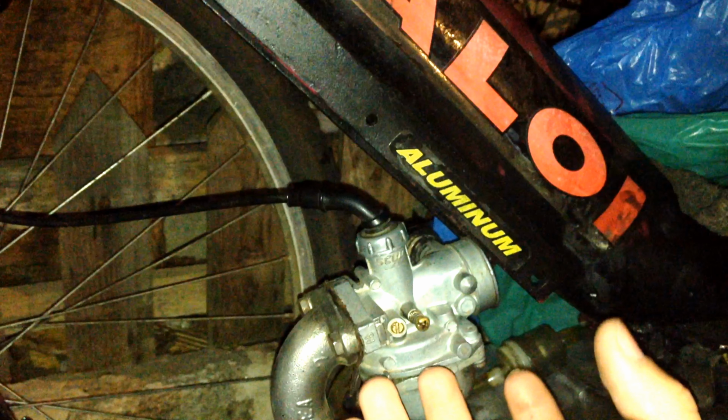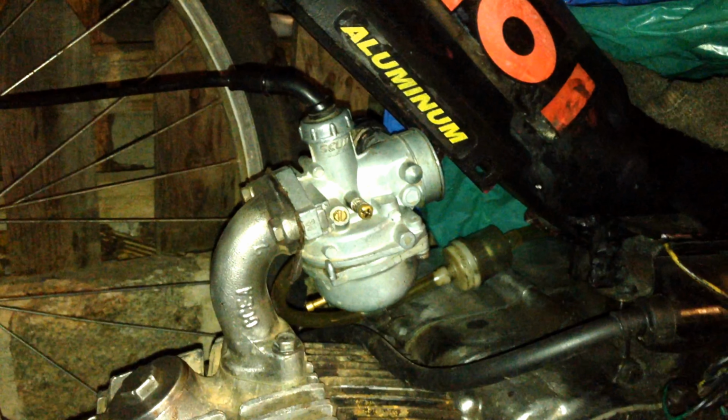Sorry about the bad angle. It will create a sort of white gooey thing on the reservoir, because it's oxidating all the metals and things in there. It's really awful, and of course, as you can expect, it just clogs everything, and then the engine quits working because there's no gas pretty much flowing through it. It's a mess. So if you have a gasoline car, do yourself a favor, never put ethanol on it. Even if you adjust the jets to let more fluid go through, it's going to ruin the carb. You'll have to send your carb to be bathed in the special chemical, or you'll have to just get an ethanol carb.